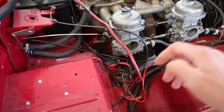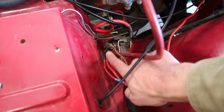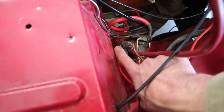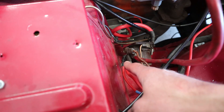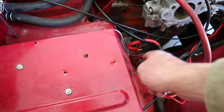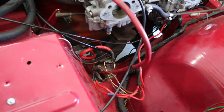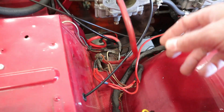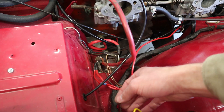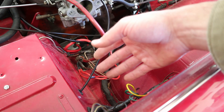The last thing I'll show here is the power wiring, which originates down here, and then I've got another one coming off the alternator. I've got kind of a gripe here because there isn't enough room to get all these terminals onto this solenoid stud. I need to do something there — I'm going to put that fuse somewhere in here once I figure out if we can get an extender or something for that solenoid stud, because this nut is just barely hanging on. There are a lot of important wires coming in and out of that spot, so I'll probably see if I can get something that'll extend this stud a little bit, or maybe a little power distribution terminal to consolidate some of those wires.